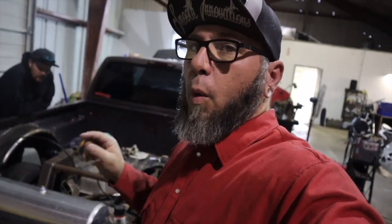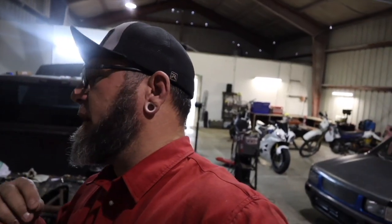Get an aluminum tank. Water will not hurt rubber in your valves. I'm sorry, people can say all they want. Water is not gonna hurt rubber. It doesn't hurt your tires. It's not gonna hurt the little rubber diaphragm in your bag, in your valve. What does hurt valves is trash, whether it be sand, or if you have a metal tank, carbon steel tank, water and carbon steel create rust. Rust creates trash. I don't care if you have a filter between your valves and your tank, something's gonna get through and you're gonna have sticky valves.